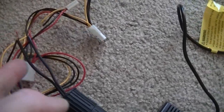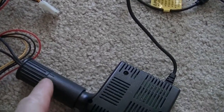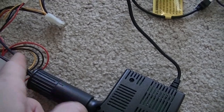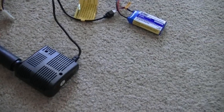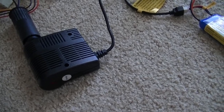So you connect your black lead to the ground lead for your cigarette lighter adapter, which would be the outside portion of it. The little inside is your positive lead. Then check it, of course — make sure that you have proper polarity before plugging in your charger. And you can see it's working; it's charging right now. It blinks when it's charging, and then it glows steady when it's complete.